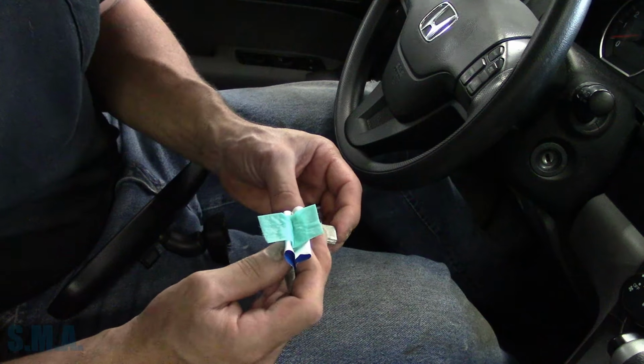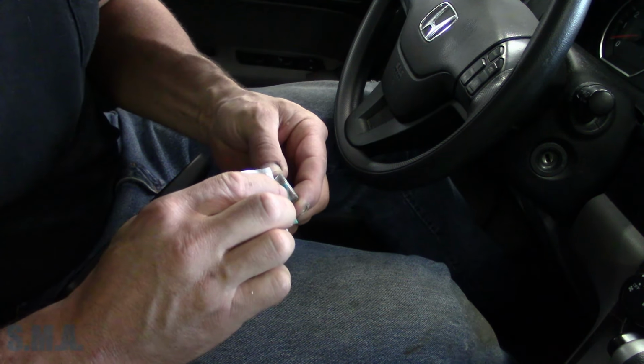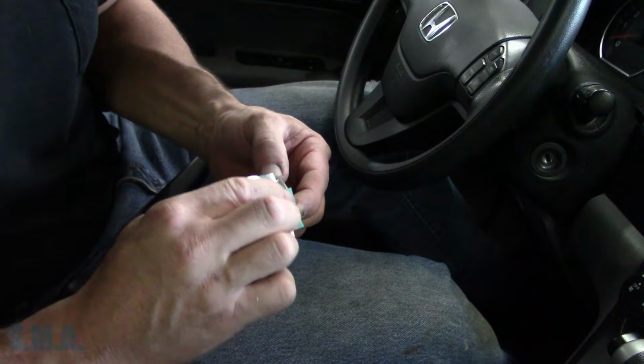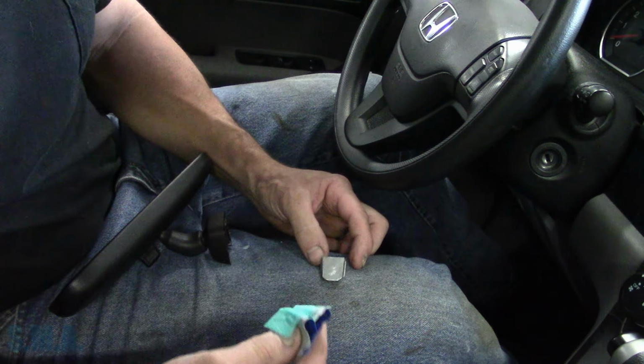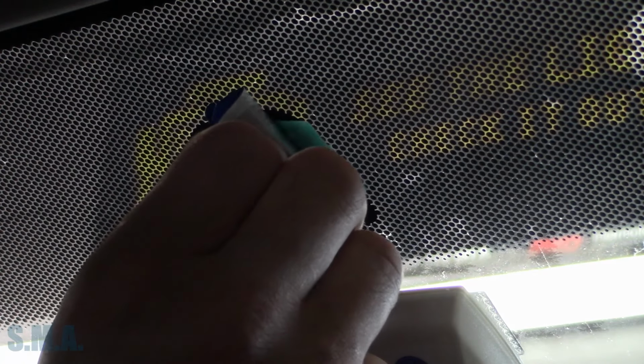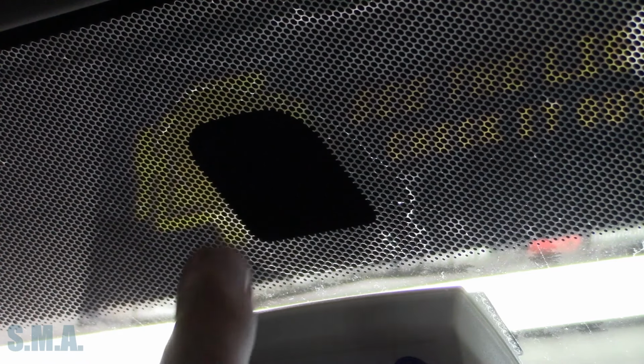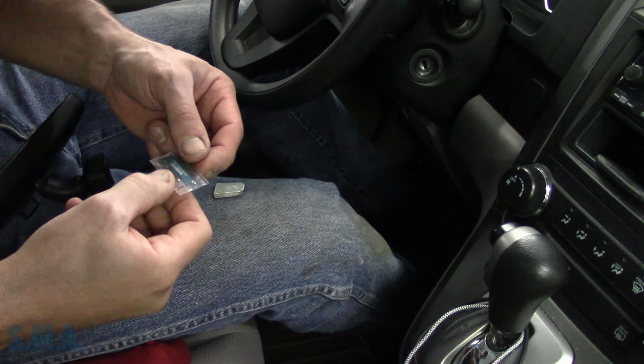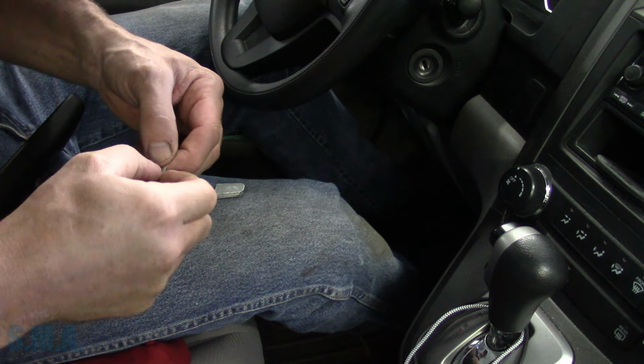And then you take this, and you don't want to get your digits on it once you get it with the activator. So you twirl this around, get it all over your button. Who's got the button? Then you come up on the windshield. Activating the windshield now. Then we activate the whole area, bigger area than even what you need. And then I would say if you don't have a very clear, distinct mark like we do on this windshield as to where to put it, prior to doing this, hold your mirror up there, have somebody go outside and mark it with a crayon or a Sharpie or something where it's got to go so you're not doing any guessing. And now, we have to open our adhesive.